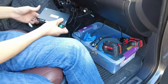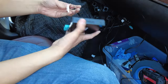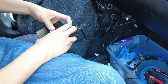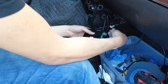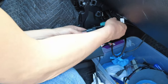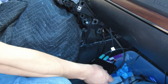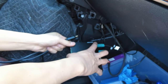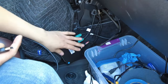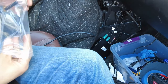We'll just let it set like this until we confirm that everything is working without any issues. Then we're going to connect our interface. This switch setting should be all pre-configured depending on which generation box you get — it's going to be different, so refer to the instruction manual for that. Connect this main connector like this. The GVIF cable labeled 'out' is going to go on the inside, and the one labeled 'in' is going to go on the outside. We have the HDMI connection here. This is all done with this connection. Now we are going to connect our new wireless CarPlay Android Auto system.